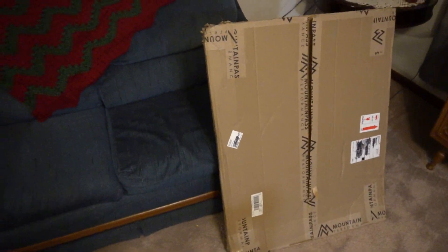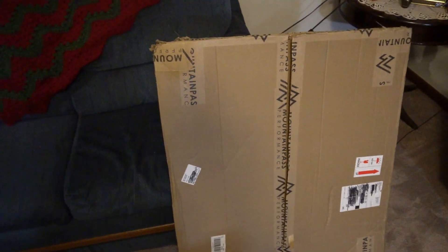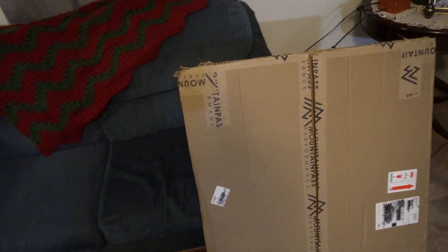The reason for this is the skid plate that comes with the Tesla is very cheap and flimsy plastic. What you'll notice will happen a lot of the time with those skid plates is they'll crack very easily, and when they crack, it can expose things like the battery coolant lines that are behind the skid plate.